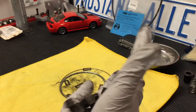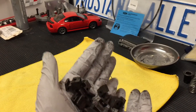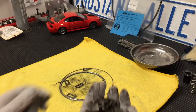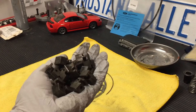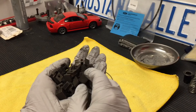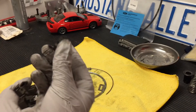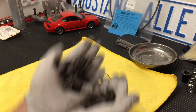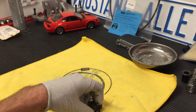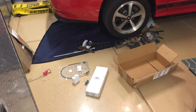I decided just to remove them. I was afraid they'd cause some balancing issues — I was getting a bad vibration and that's just so much weight to add to the outside of the clutch. My cousin had these on his clutch too, and one of them came out and was laying in the transmission, really out of balance. You can imagine just missing one of these — what kind of damage that would do. I got rid of them, but you do have to basically pull the transmission back for it to clear the throwout bearing to get them out.